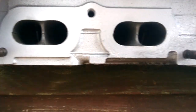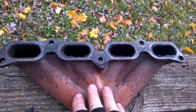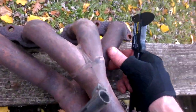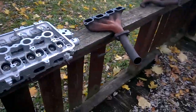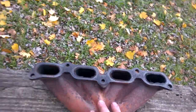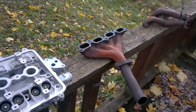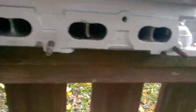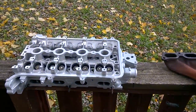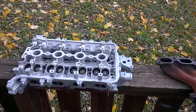Now, if you decide to go the route of port matching, you'd be taking the metal out of the cylinder head. I am going to recommend that you use the manifold — port the manifold out to match the gasket, then port the cylinder head. The reason being: when you start taking metal out of a header, as you can see, you've only got a few spot welds that actually hold this thing together. Not saying it will necessarily cause a crack in the header, but once you start taking metal out and adding heat and then it cools down, you run the risk of cracks. So the manifold would be better suited if you were doing a very large port on the exhaust side, which can provide a substantial gain over the design of the factory ports. But as you can see, Saturn covered it pretty well and there isn't much needed other than maybe a little bit on the center of each port. If you have any questions, feel free to drop a comment. Thanks for watching. Have a great day.